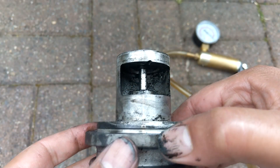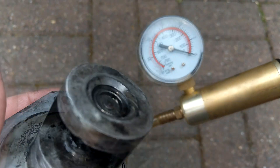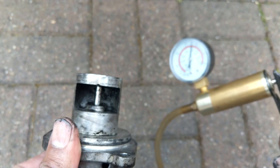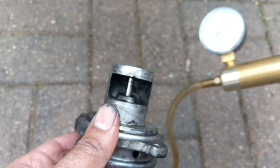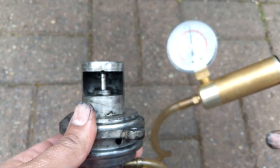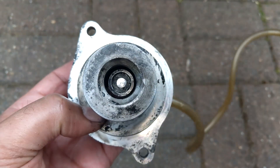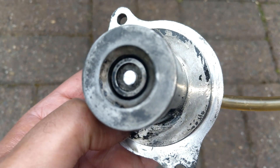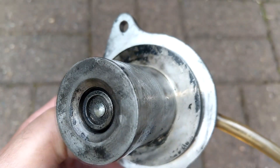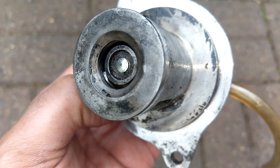After copious amounts of cleaning, I managed to get it all unstuck. I also sanded around the circular part where the valve enters the valve housing. As a result of that, I managed to get it so it just doesn't stick at all. Now it starts to move once you've got around about 10 inches of mercury in there — so it's a much lower point. When the EGR solenoid delivers that vacuum to the actuator, the actuator is ready to move at that precise time, so you then get the exhaust flow that the engine expects. I cleaned up the surfaces around the circle there because it was really quite sticky around that part, and I really took my time to make sure there's no sticking in that area. As soon as the vacuum is applied, the valve opens nice and easily and closes once the vacuum is taken off.